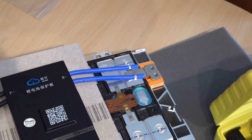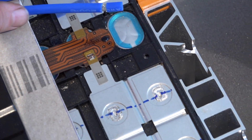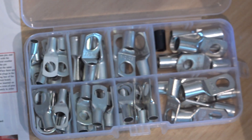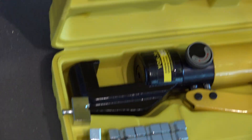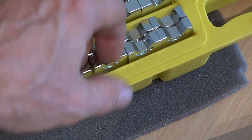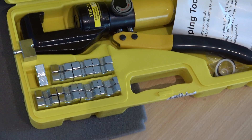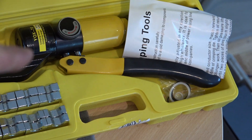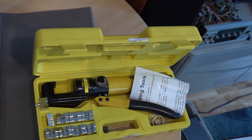Annoyingly, the JK comes with very fine flexible silicone wire - I think it's 7 AWG, probably about 8 or 10 millimeter square wire. It comes without any spades so I've got some spade connectors. I've also got this hydraulic pump-action 10-ton crimp squasher with all the jaws for different size crimps - it's for crimping lugs onto your battery leads. I tried it out on a piece of battery lead and it just completely squashes it with hardly any effort at all on this size wire. Quite impressed with it - it was about 40 quid.